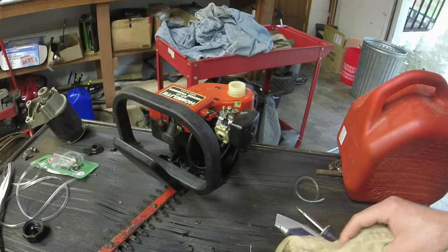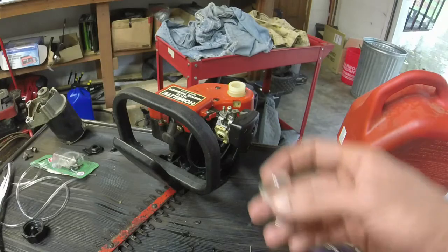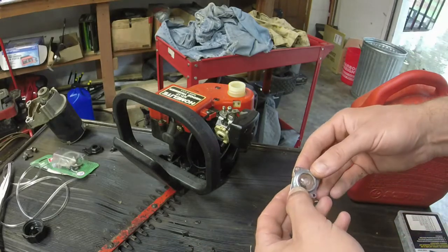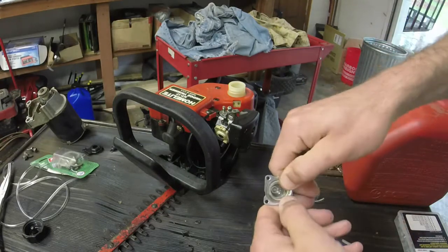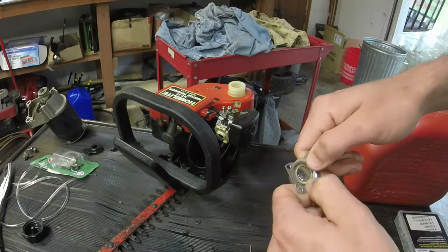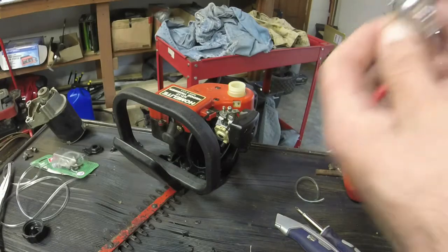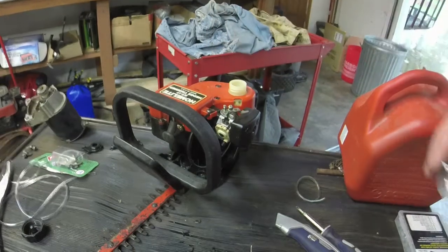Kind of like this. I haven't really needed any, but these are, I guess, the newer, bigger primer bulbs that come on the Zamas. They'll actually work okay. You just kind of have to work it in there a little bit, especially in the back here. Just got to make sure that you get everything pushed in on it. They will fit though. I put one on that 19-inch right over there, just off camera. They look a little like you've had a bit too much to eat one night or something.